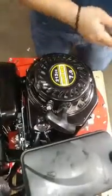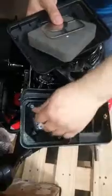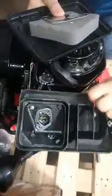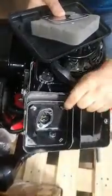First you need to take off the air filter, which is this. This screw comes out down here, and the filter comes forward like so. Take out the filter itself. There are two bolts in here — take these off. You're going to have to ratchet these off; these are already loosened for showing you how to do this. Move this aside for now.